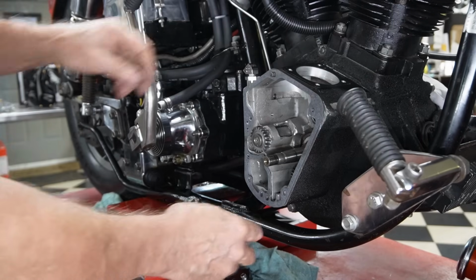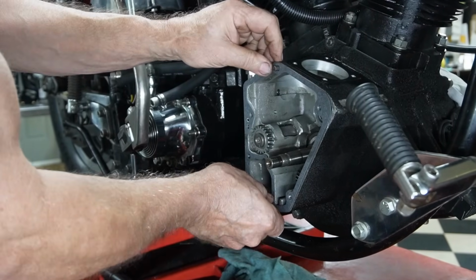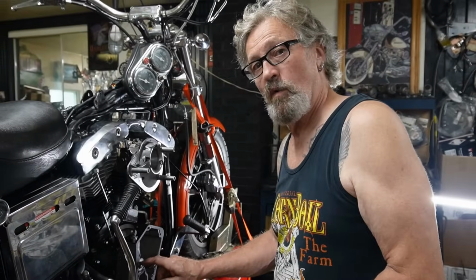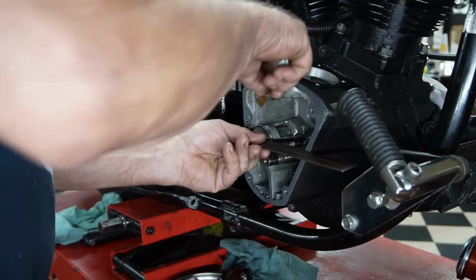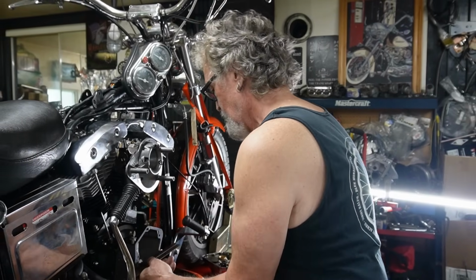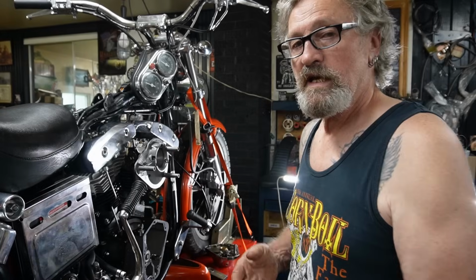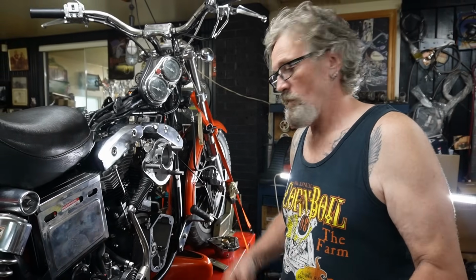So we get our gasket. I use James gaskets and we don't use the cheap ones because that's not what we want. What we've done is put a little washer on here, and we check the thickness to make sure that I got like 10 thou. I like to get that. And I've just got 10 thousandths of an inch there. And the gaskets, they say, will crush 6 thousandths of an inch. So that gives me 4 thousandths of an inch end play on my breather gear, which is what we want.